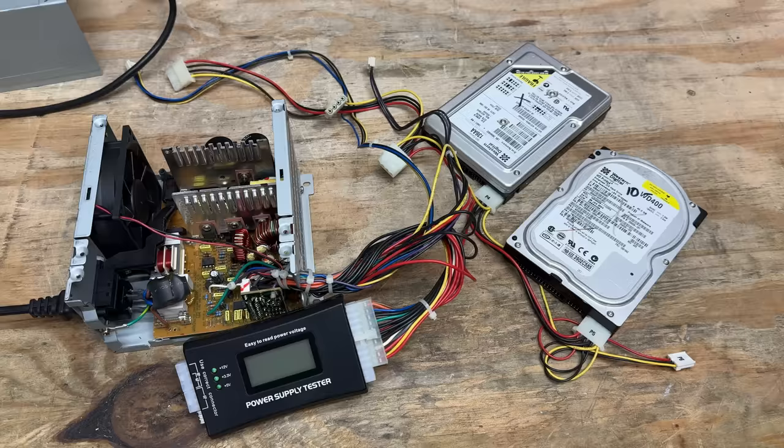With that drive cage out of the way, we can get a good shot of that motherboard - it's an Asus P2B-VT. Looks like this board could have had onboard video and sound, but those are not populated. Interestingly, they tell you what these spots would have been populated with - there would have been a Riva TNT, and sound would have been an Ensoniq ES-1373. The RAM stick is made by Hyundai - I love the way Korean companies just make everything. This is a stick of PC100 that does not identify its capacity, so it's anyone's guess.